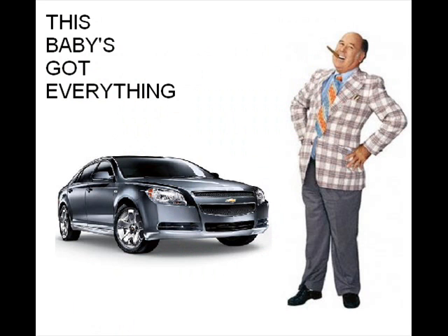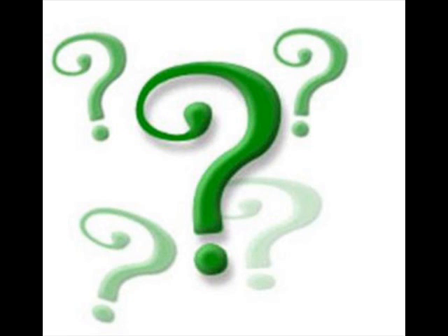So, how do you get this on your car? Well, more than likely, you already have it on there. Virtually every fuel-injected car has this, as far back as the mid-80s, maybe even farther. If your car has this, why am I telling you about it? You can't really use something if you don't know about it. One of the good things about DFCO is it kicks in every time you take your foot off the gas pedal. With no throttle, there is usually some sort of lag time — usually a few seconds — and you're good.